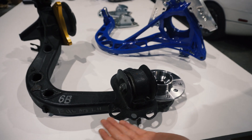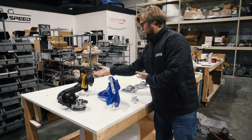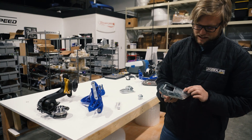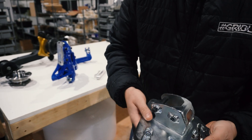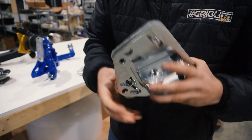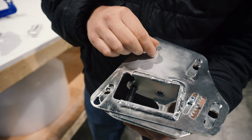You've got a little bit of adjustment, they run good. One of the big upsides of this kit is that no longer do you have to press the wheel bearings in and out — you just bolt them on, so that's easier for servicing. Toe adjustment is done by spinning this thing, which spins this round piece inside, which then slides this piece around. So it's like a multi-piece deal — essentially much easier toe adjustment on the fly.